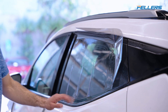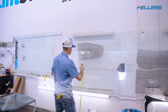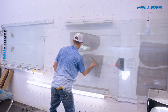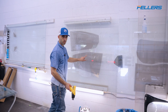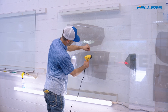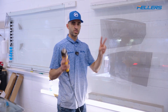This is going to be more than enough shrinking. Or what I can do is come over to the peel board, use my TrueSpray system to wet the board quickly, lay this down on the peel board, take a big traditional squeegee and squeegee it out nice and firm, getting the majority of the water out from underneath the film. Then I'll take a heat gun and grab my film. The trick is to not let these corners come up — if they come up, it's going to instantly over-shrink. I grab the film, create a little pocket not letting the corners come up, and shrink this pocket just like I would a back window or windshield. When my thumb gets hot, I move my thumb and let that get tight. That is what I call a generic shrink.